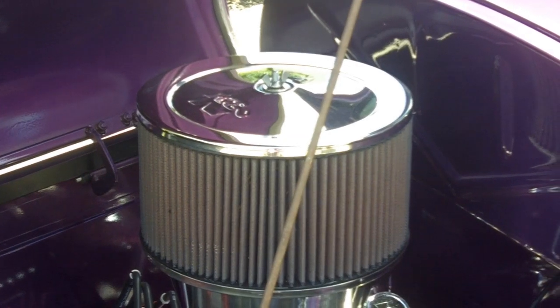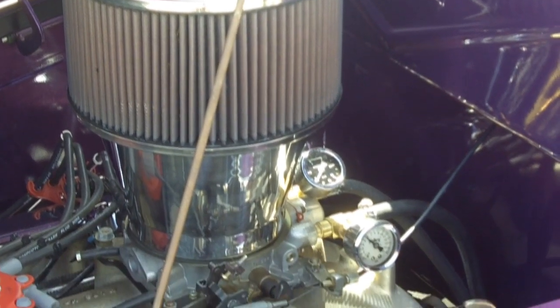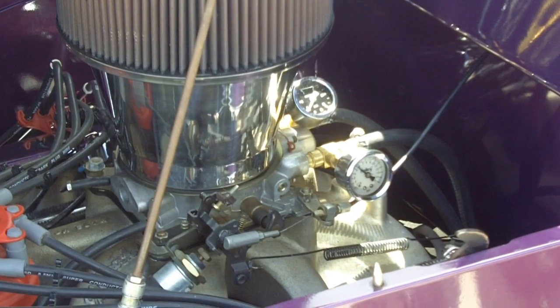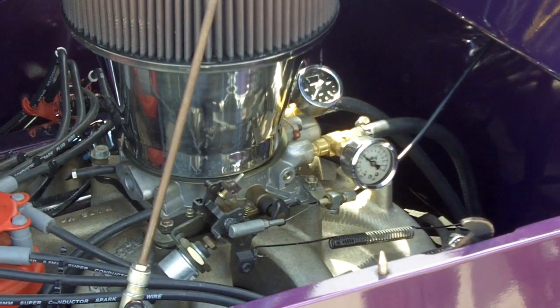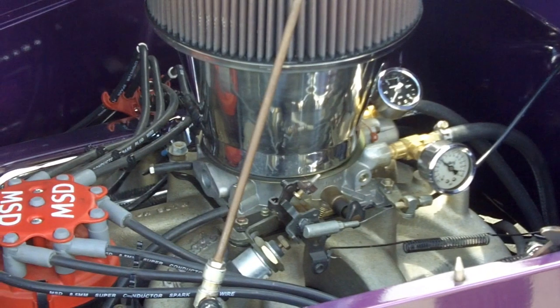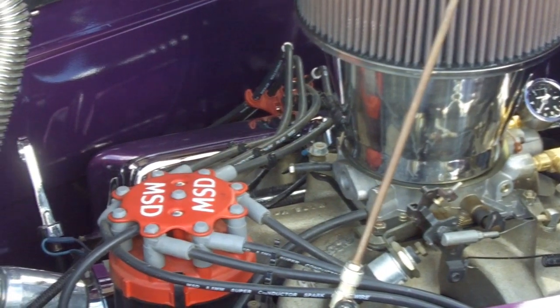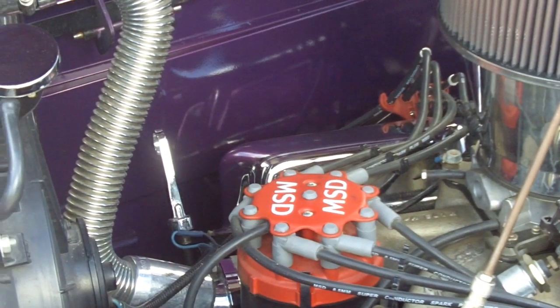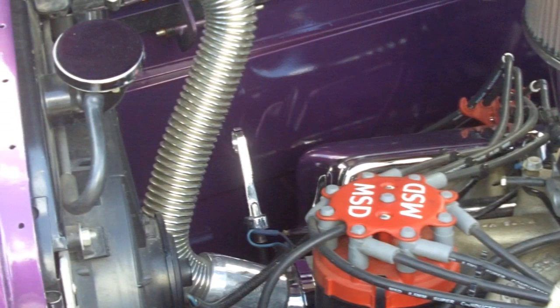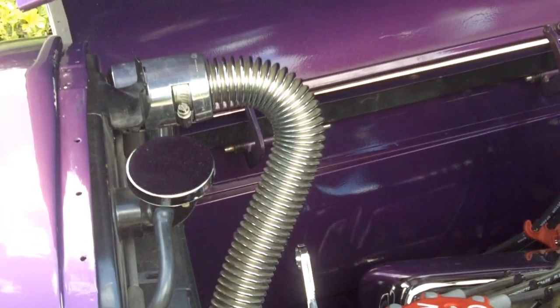Underneath the hood, believe it or not, is actually a Ford motor. You don't see many of these street rods where they use Ford motors. It's a 351 Windsor with 400 horsepower. It has Dart competition heads, the Holley fuel injection system, a Comp 280 cam, Keith Black 10-to-1 pistons, and roller rockers as well. It's unbelievably quick.